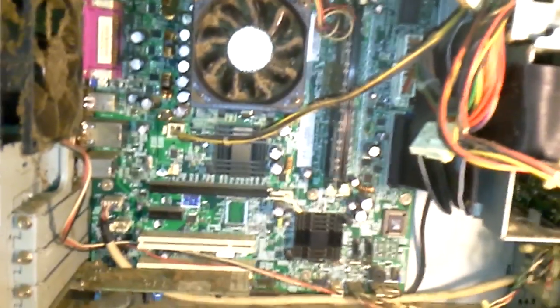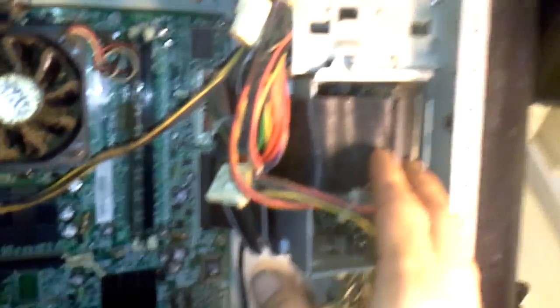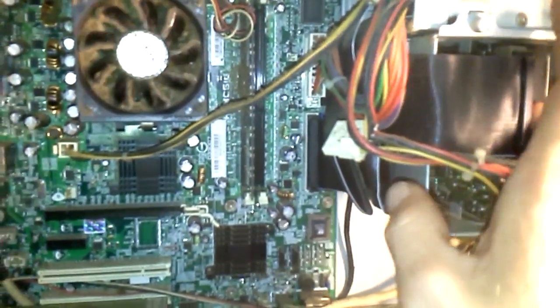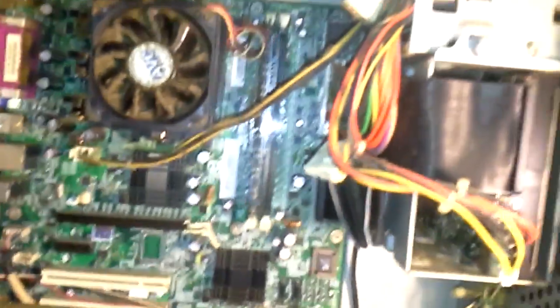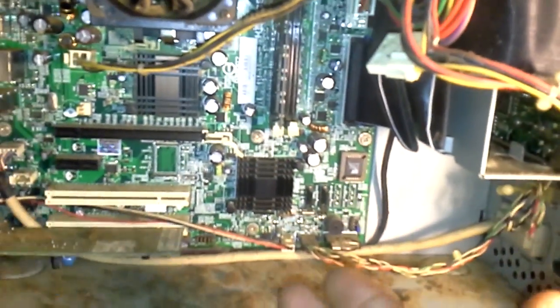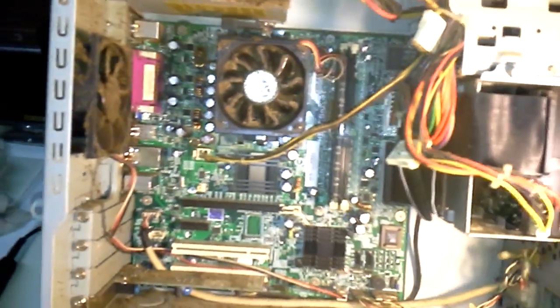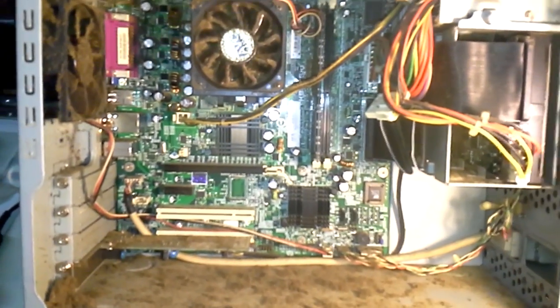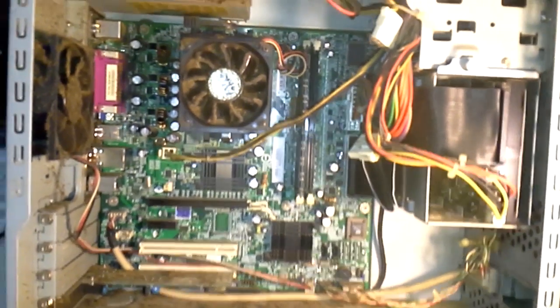Another way to solve a lot of problems is to install a fresh copy of Windows on your hard drive. If you can't get things working by clearing the CMOS and cleaning everything, pull out your hard drive, take it to a friend's house, hook it to another PC, and download Windows from there. A lot of times it's a conflict between drivers, the BIOS, and chipset drivers — it can all be a mess if you've been swapping systems without deleting old drivers. If you have any comments, tips, or your own fix for this problem, leave it below to help others. Please subscribe — thanks, bye!